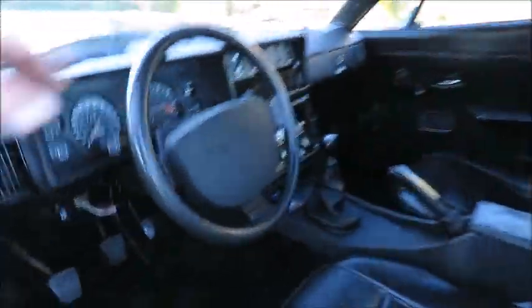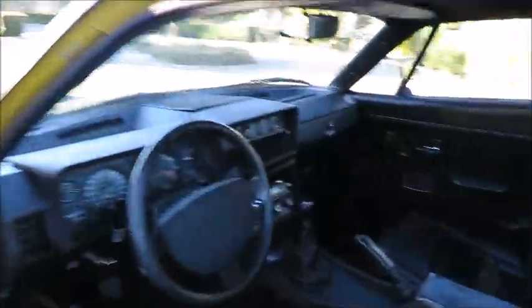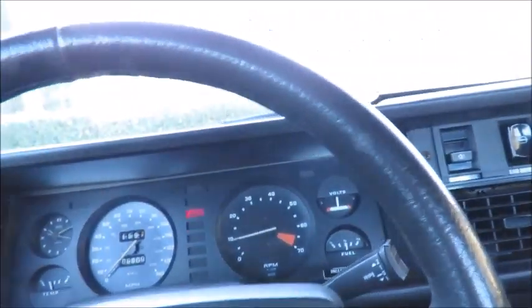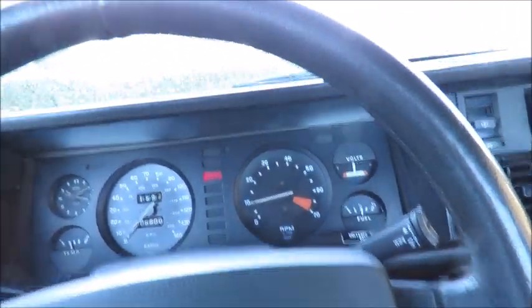So while we're doing this, let's turn off the hazard light and let's check the blinkers. That's the left blinker. And the right blinker. We got a right blinker. So it looks like we have to look at some bulbs or a flasher unit or something to get that in order. I've also noticed that the horn switch is a little jiggly.